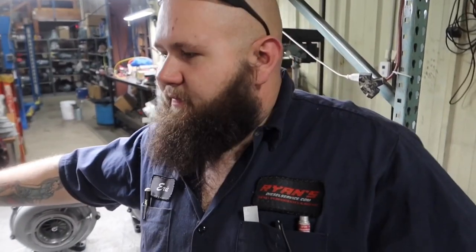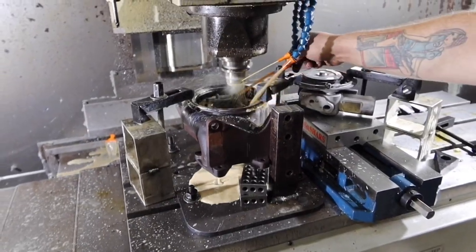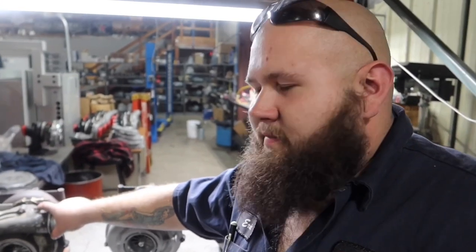When asked about a favorite turbo for stock applications, the LLY stands out because it's the biggest turbo they ever put on from the factory. If you want to build a 64mm turbo, you've already got your 66.5mm turbine in the back. You'd need fewer modifications — you can take an LLY turbo and it keeps things nice and simple since you already have that larger turbine.